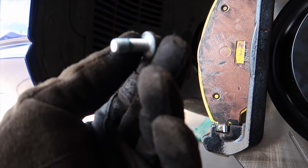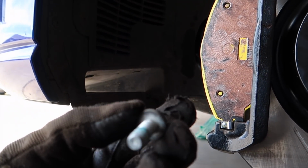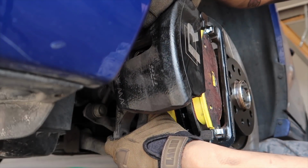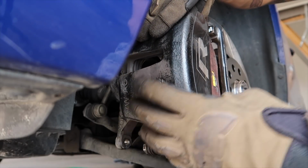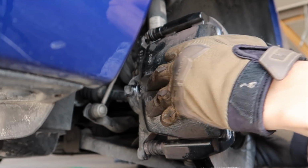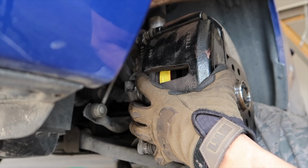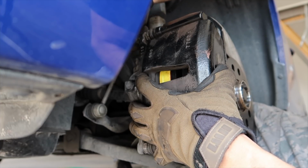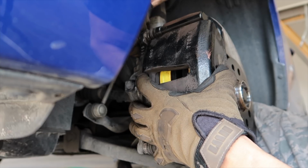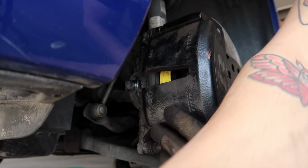Volkswagen does recommend to replace these. And as you can see, there's some Loctite. You should definitely Loctite them. So, do that. Pretty easy stuff. Should slide right on. Get that top one in, and you'll have to hold that bolt again. Remember, once you get a little bit of torque on there, they'll start to turn. So, at that point, I'll just go to the bottom.